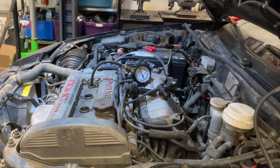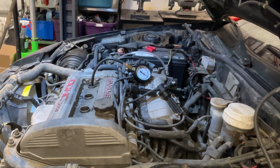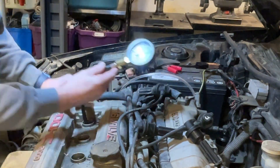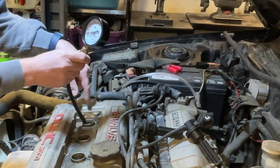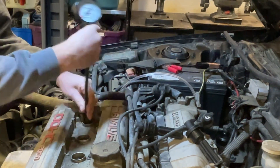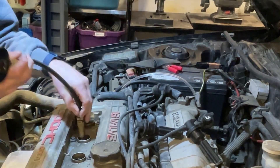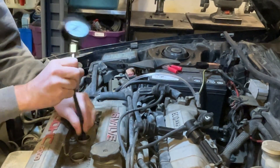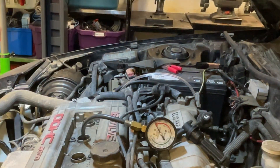Try this last one — and that one is about 150. So we've got 155, 155, 145, and 150. I'm not too worried about this one. I do want to re-test that low one before I put any oil in, just to see. Maybe I wasn't getting a good enough seal on the O-ring. It's doubtful, but I want to make sure before I drop any oil in, because I could be misdiagnosing otherwise.